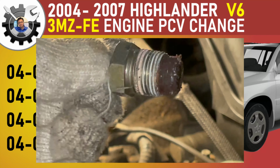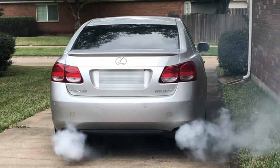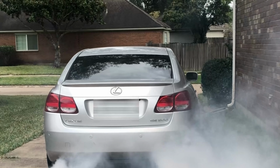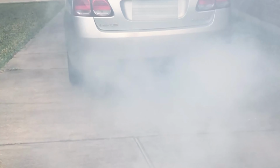The first major benefit is that a properly functioning PCV reduces pressure inside of the engine compartment to minimize compromising internal gaskets that can cause oil and coolant leaks. The second benefit is unburned fuel is given another chance to combust cleanly, which reduces emissions in exhaust and minimizes contaminating and damaging the catalytic converter, which is very expensive to replace.